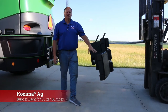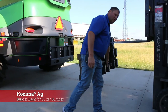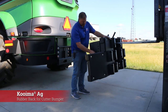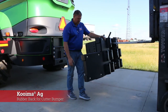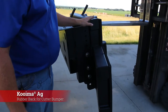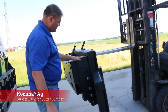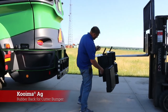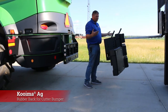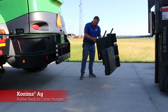Now we're going to install the complete rubber back. The fork hole pockets are not exposed because we want to keep the rubber on the entire back. You pre-install this just using the 5A bolts in the instruction manual and the bolts provided, to your desired height. Most guys will run about this height — so there are a couple holes exposed. Pre-install this onto here; it's self-explanatory with the instruction sheet included. Then I like to pick it up right in the center — it balances very well.